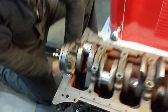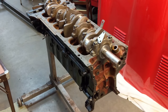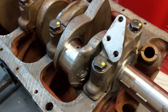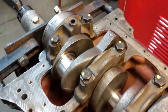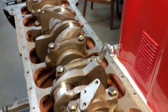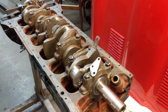Just dropped a little oil in there - dad filled it up and it's totally running free, that's lovely. Made some good progress. Got the crankshaft tightened down, main caps all tightened down. Opted not to use the lock tabs - my dad thought just stretching the bolts was good enough, those lock tabs are kind of old hat technology. The rope seal went in - you guys saw that process - and the crankshaft is still turning. In future episodes, we'll be putting in the pistons, the distributor drive, and the oil pump which sits right here, and then maybe the oil pan. So we're well on our way. That's it for this episode of my junk E-Type engine - thanks for watching everybody, see you later.